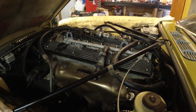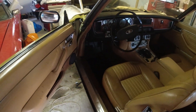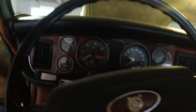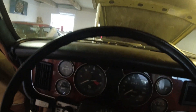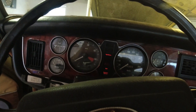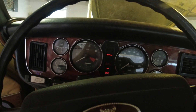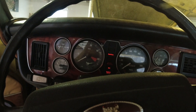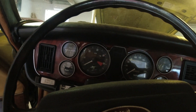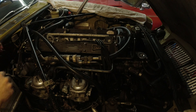Got it all back together and filled up with coolant again. Let's fire it up and see if it works — let's also see if it works with the key. I haven't messed with the relay but I cleaned the connections on it. The next step would be to take the relay apart and clean the points in there. Let's see. See that relay? All right, let's go out and hotwire it — I'm not going to really deal with that relay right now.